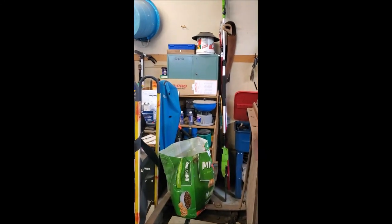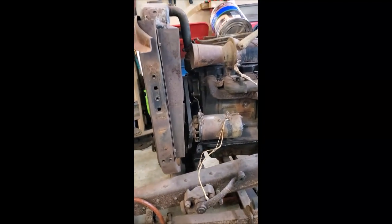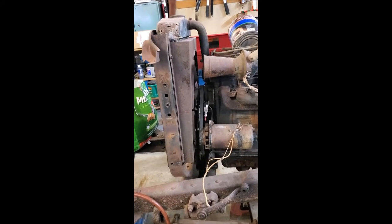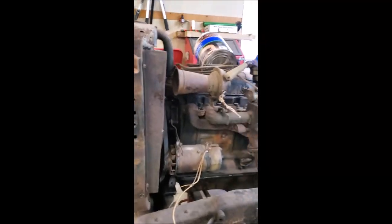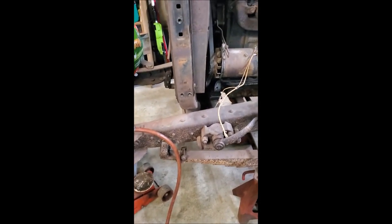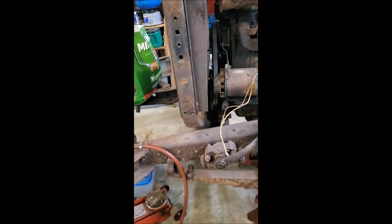And I've got a gasket set. As you can see on the shelf over there, that Felpro box, I'm gonna put a complete gasket set in it because a lot of stuff is leaking. Pretty sure we're gonna have to put a new water pump in it, but I haven't looked to see whether these are rebuildable water pumps or not. So once we get that off, I'll take a peek at that. I'm hoping it's not the radiator that's leaking, but we'll have to take a look. I know I filled it up, and when I ran it, water was pouring right out of the water pump. And then as it sat, after I drained it, it was dripping out of the lower part of it for some reason, and I just don't know where in the front end. I couldn't tell. I didn't have it this cleaned up.